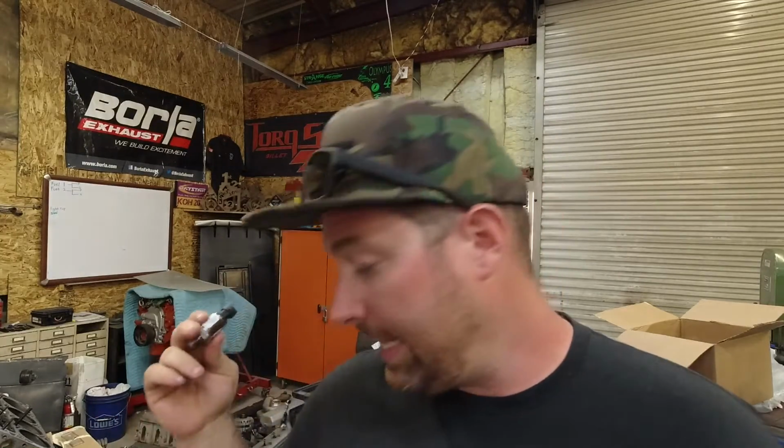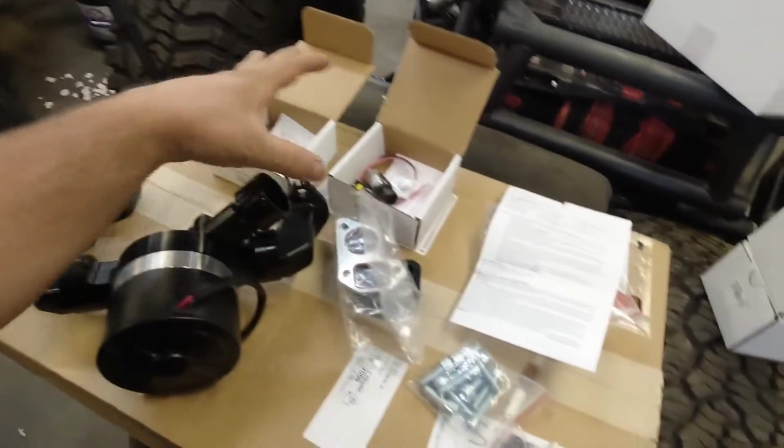If you're using the factory LS oil pressure sensor, you have to program it in the Holley. We didn't know that. So when we talked to Holley, we found out that it was programmed for the Holley sensors that Holley sells. Now you can use the OEM ones, but these are better. More expensive, so hopefully they read a lot better, but from what we're told, these are a very precise unit, and that's what you want. So we're going to make sure that the car has the best sensors on it so that we're getting the most accurate readings. So if there is a problem, we can find out soon enough versus having an issue. So that is why the computer was reading 3 psi. It was something we didn't know, and we learned, and hopefully now you know. So if you do a Holley swap on your LS, if you use the factory sensor, you have to set it up in there. So that's what we got going on in these boxes.